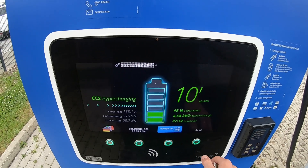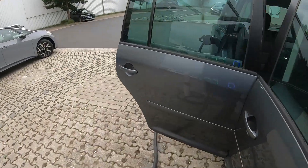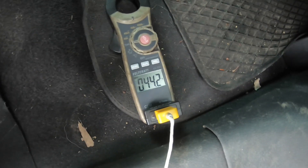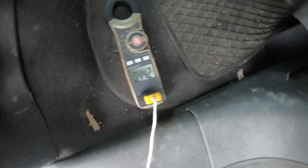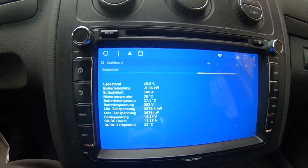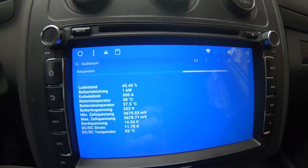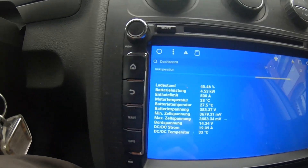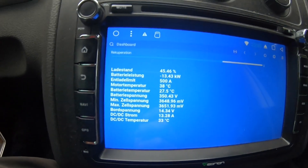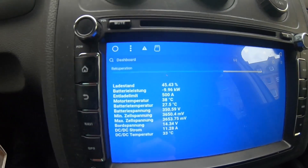Let's stop now and look at the final cable temperature — and that would be 44 degrees. That's pretty good. The charging is finished and the batteries have heated up from 17 to 27 degrees after just seven minutes of charging, and I'm running the fan. I'll drive back home, which isn't far, and see if we get any drop at all in battery temperature.